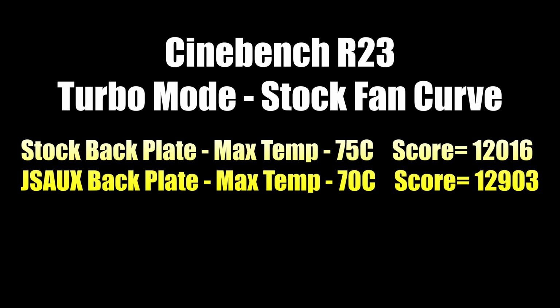First run with Cinebench R23 was in turbo mode, stock fan curve on battery. Didn't mess around with anything. With the stock backplate, by the end of the run, our maximum temperature on that APU was 75 degrees Celsius. We got a score of 12,016. With the new backplate, our maximum temperature dropped down to 70 degrees Celsius and it also upped that total score to 12,903. The up score really isn't anything to write home about, but I was really surprised to see that we actually dropped that temp by 5 degrees Celsius.